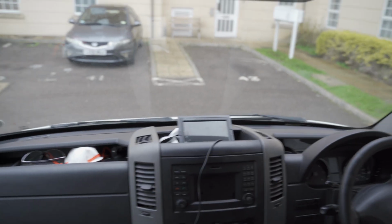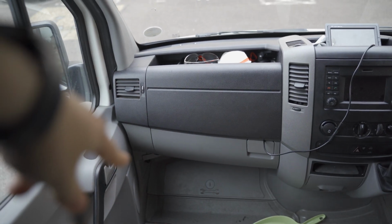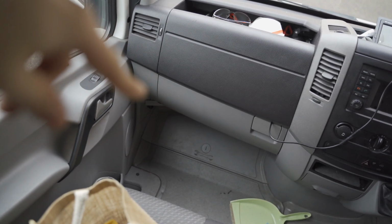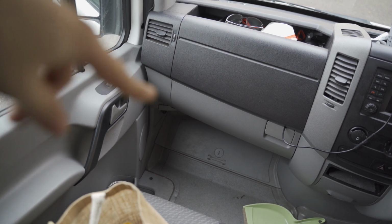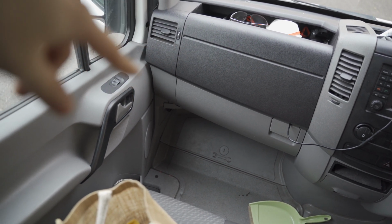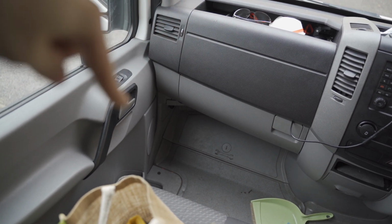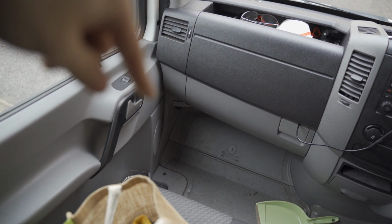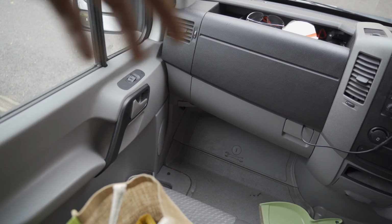As you can see, we have got the camera monitor temporarily wired in there. All I needed is a negative from there, but I hid all the wires in there. Use the negative terminal. There's another bolt going in there. I did not splice in there, I just attached to that negative terminal. And the positive for the monitor, I spliced in the positive that comes with the camera video cable, and there's a little positive end like this on the cable if you're going to look at the kits.